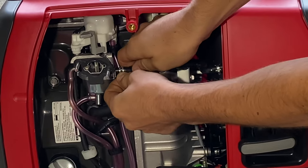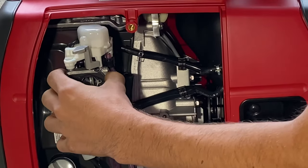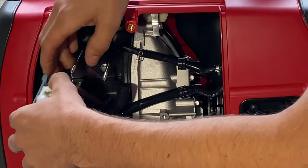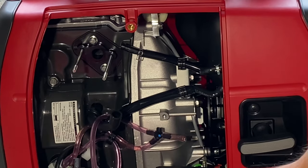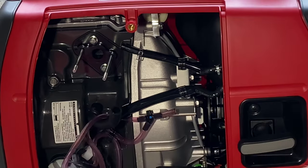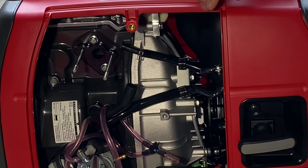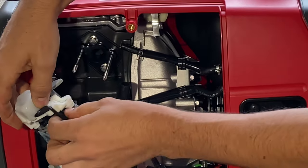Go ahead and disconnect the fuel line here. You're going to have some wires and hoses for the overflow coming out of it, but that's okay. The connection runs right up in there, but I think we're going to do it without having to take the carburetor completely off. In some cases I'll have to dip the carburetor in chem dip carburetor cleaner, but I don't think we're going to have to do that in this case.